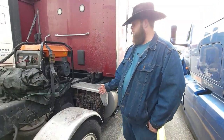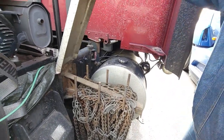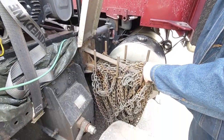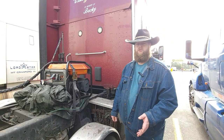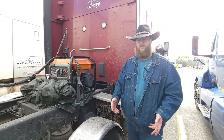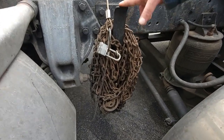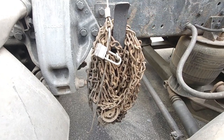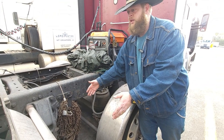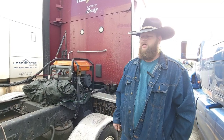Here on the side of the truck we got chain hangers so you're able to lock them — there's a hole here and here to put a lock through. These are all of our single chains for our trailer and our steer tires. We got two sets of singles so we have an extra in case one breaks, because you must carry extras — these things will break whether they're old and fall apart or you're going too fast. Back here we got the angle iron hangers on both sides of the frame rails, and here we got two doubles — doubles meaning they cover tandem tires — so the whole tractor is covered.